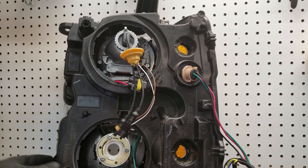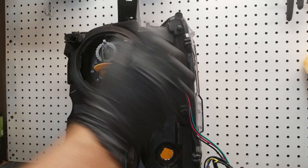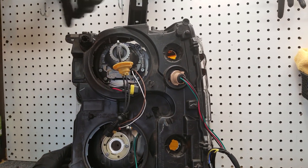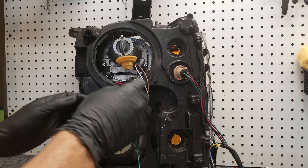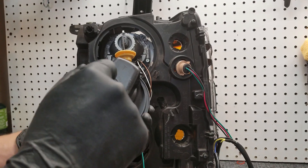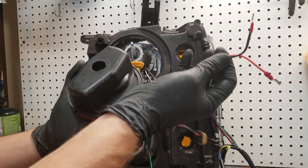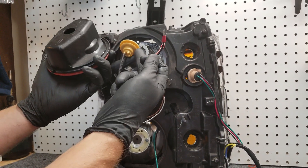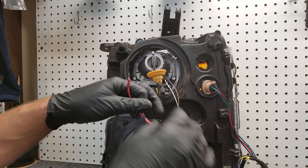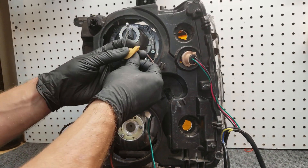All four screws are tight; that projector's not going anywhere. You will have to adjust your headlight once it's back in the vehicle — it will change the height slightly, but with the adjustment screw you can easily readjust that. Now we're going to take this cap. I already drilled a one-inch hole in it with a step bit. I'm going to take the low beam plug that was initially inserted through here, pull it through, and feed those wires through — then put them back through here. It's a little bit of a pain getting them back through.